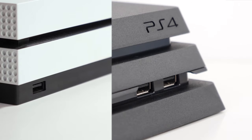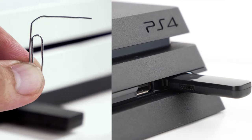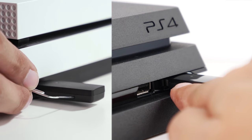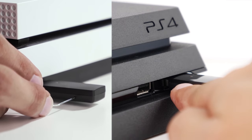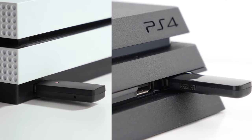Next, turn on your console and plug in the dongle into one of the USB ports. If you are trying to re-pair for Xbox, you'll need a paper clip or a pin to poke into the pinhole. Then press and hold the button for 5 seconds until the LED on the dongle begins to blink rapidly.